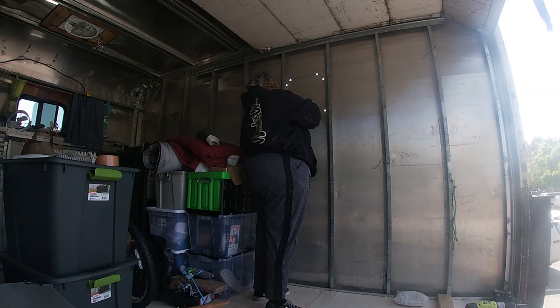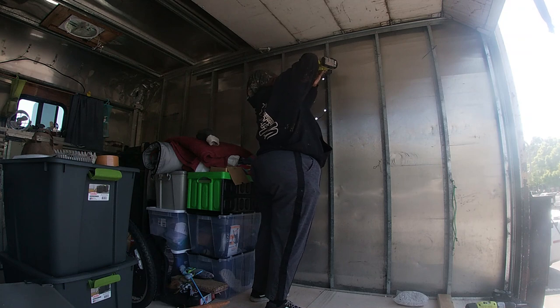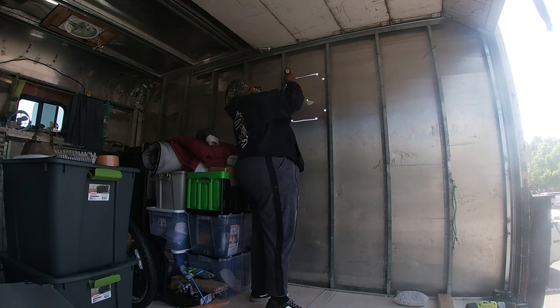Before you cut a very large hole — small holes can always be filled — it's always good to check your work again. So I got another perspective on the window from the outside of the truck. Once I was happy with what I'd set up, I used the drill to set a couple more holes that I could get a jigsaw blade through before I started cutting the whole thing out. Then it was time to get out the jigsaw. For the top and bottom cuts it was easier to do those from the inside of the box, then go to the outside for the sides because of how the window was positioned between those two metal vertical rib areas.